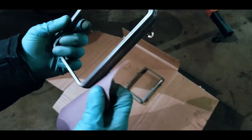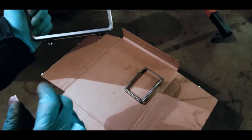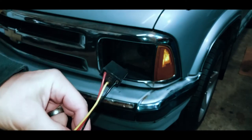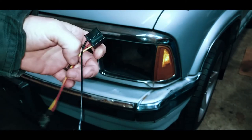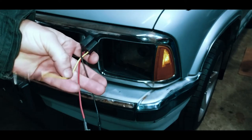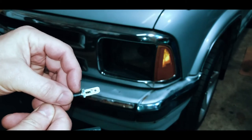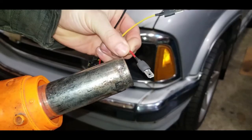I can't install these bezels as-is — I'm definitely going to paint them. I'll get them roughed up and shoot them with some black. They give you a little jumper harness because they don't know if their lights are plumbed up right. In my experience you're going to want to run the black to black, the red to green, and the yellow to the other one. These terminals stick out for some reason so you're going to want to cover them up with either electrical tape or a little bit of heat shrink.